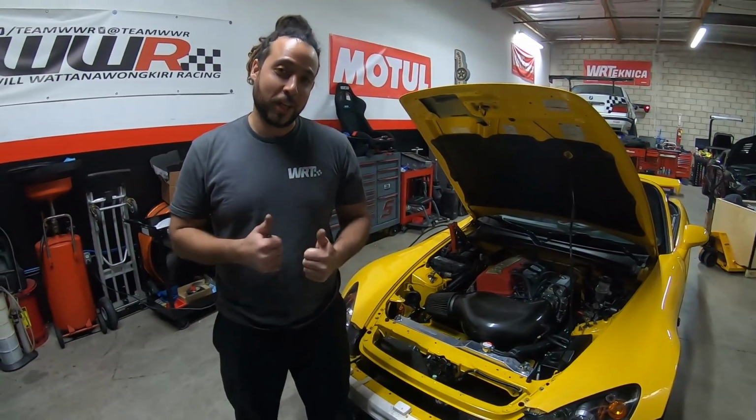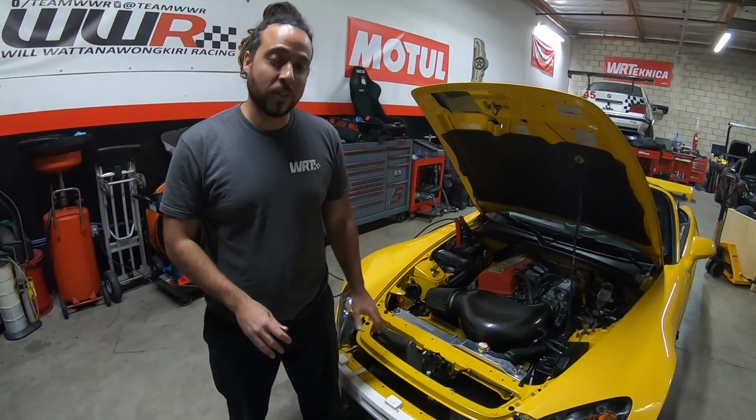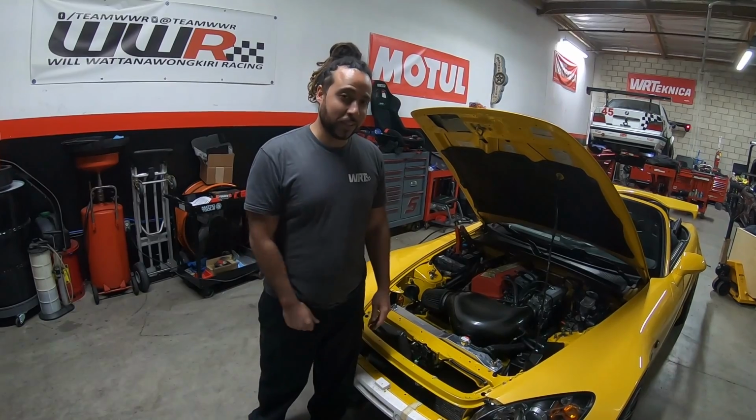I just got the flash uploaded, got a charger hooked up. We are going to go ahead and crank the motor over, no fuel pump fuse. Make sure we prime the oil pump, get oil everywhere in the motor, and we're gonna push the fuel pump fuse in there and send it. Let's go.